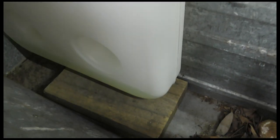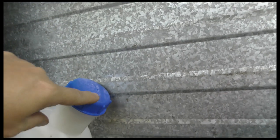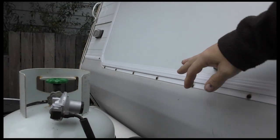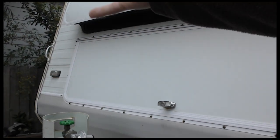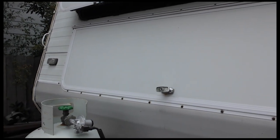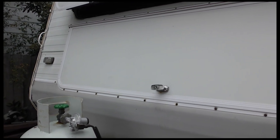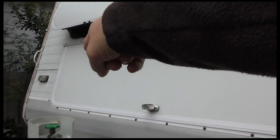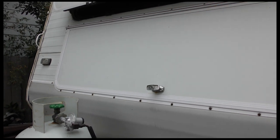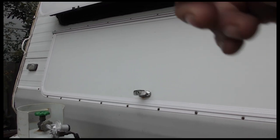That's our fuel tank there and the piece of timber that supports the weight of it. It's getting a little bit low and we need to top it up. I've been topping it up periodically just to see how much fuel we're going through and to make sure it's working. This fuel tank does have a little breather hole so it's not going to create a vacuum. The fuel tank is protected — protected from the sun, from the elements. Nobody can see a diesel fuel tank sitting there, it's not going to be hit by stones. So I really think that's an ideal install location. If you've got a boot, you've probably got drain holes in either corner like I did. If you've got to pop a hole in the bottom and run the fuel line out, no biggie — I think that's definitely the way to go.